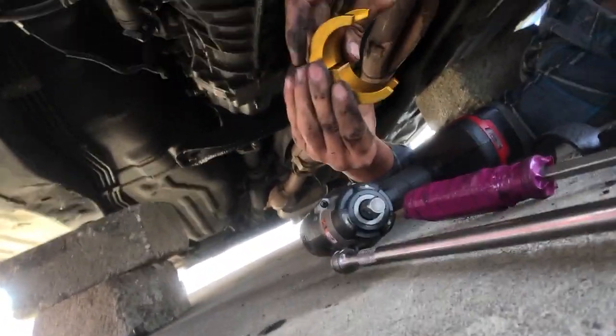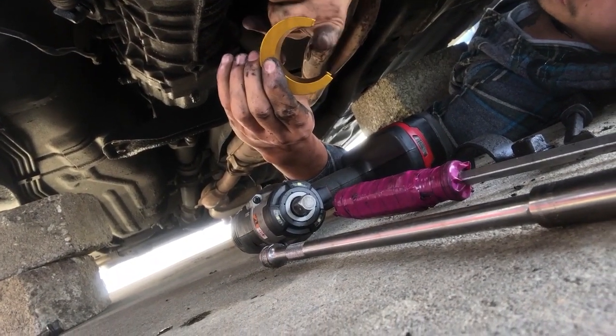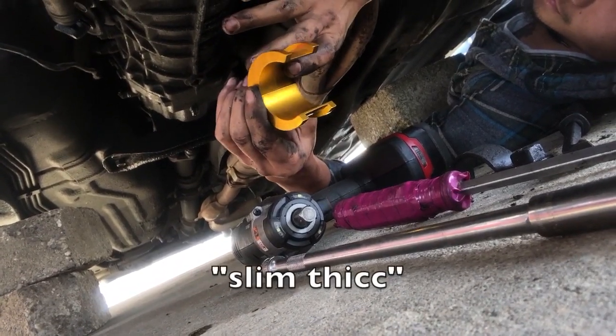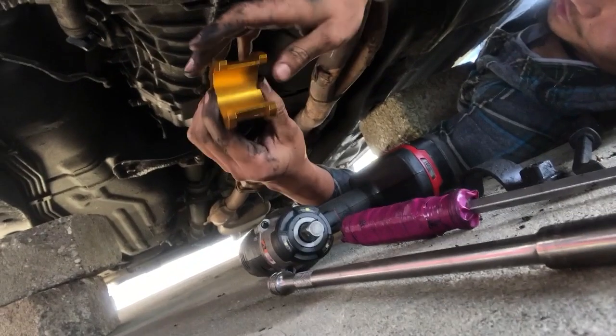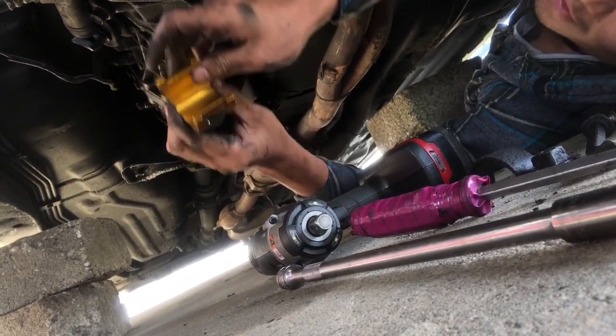Why did I choose to start a car channel? It's so expensive, it's so dirty. Anyway, this is what I was talking about — the C-shape that the bushings are in. This open space is so the rack can move forward, that's why it's thin on one side and thick on the back. They're called rack offset bushings — I don't know exactly, PBM sells them, that's all I know.